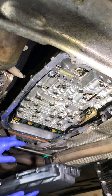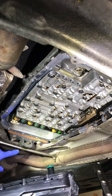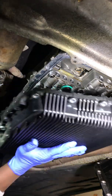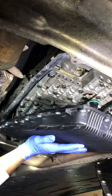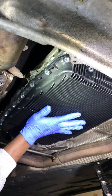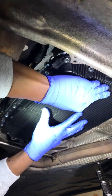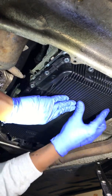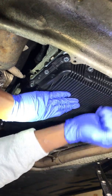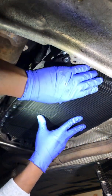Unlike the X5, on this 7-series there's a support mount that sticks out right here. So if you go in this way first you might have issues — you want to come in from this way to clear that area, then go up. Bingo. So that little resistance we're feeling right here, that's the actual filter — the pickup point with the seal — wanting to go in.